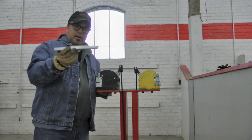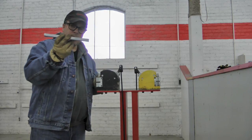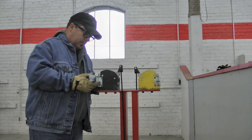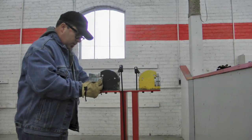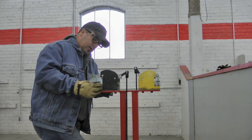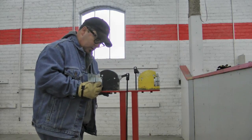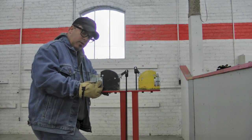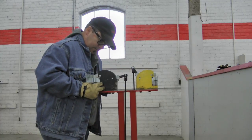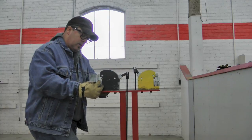Okay, so I've already pre-lined this. This is for the passenger side rear quarter window. I've already pre-measured out where I need this to be. Okay, so fully up against the rest, and I'm taking bites and then gradually moving it along. And I'm studying how that curvature is being created. Because if you get exaggerated on it, you can always stretch it back out some.